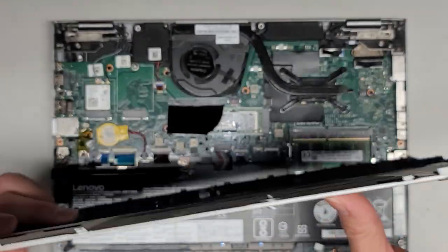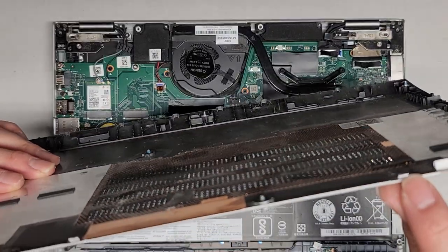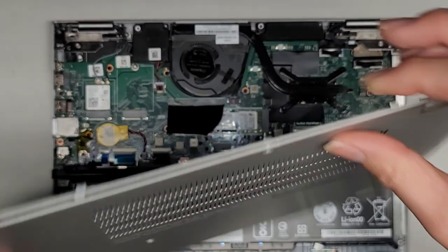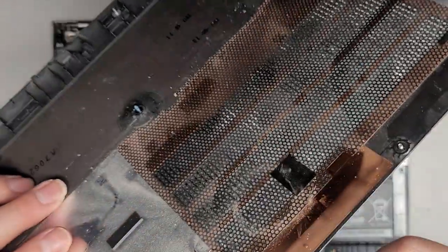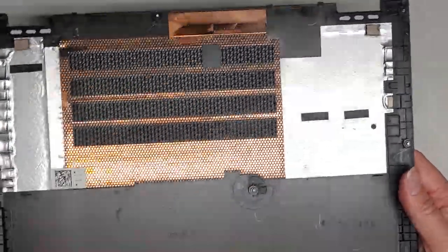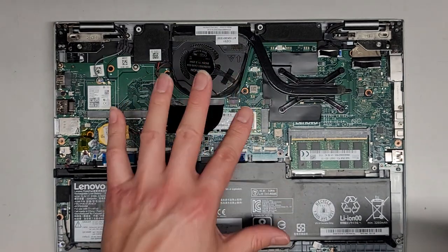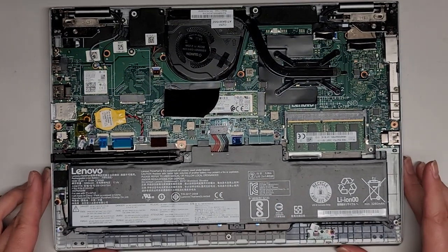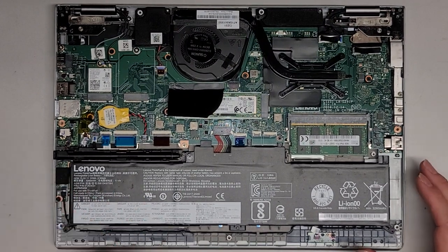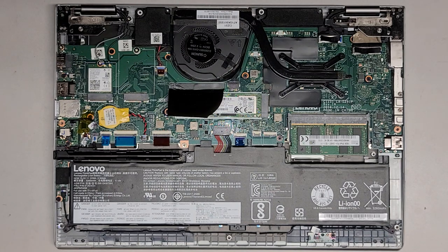The customer already tried to get this out on their own. You can see these little clips here — they actually go into the back case and stick out a lot further. So if you try and rip this side up, most likely you'll end up breaking these clips. I actually did clean out the inside earlier before making this video because it was having issues turning on — I did a battery reset, CMOS BIOS battery drain, and everything, and still wasn't able to turn on until I cleaned all this up.